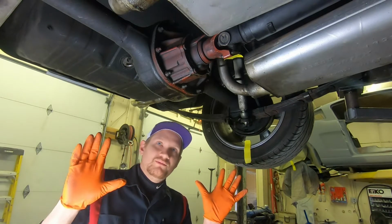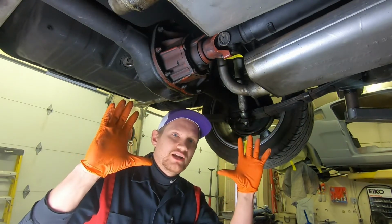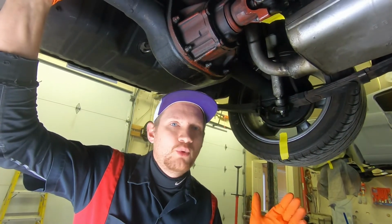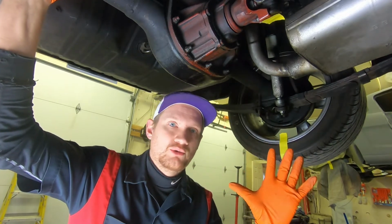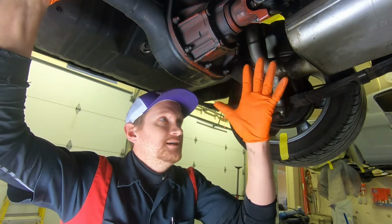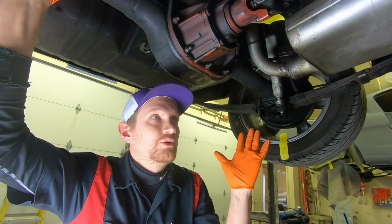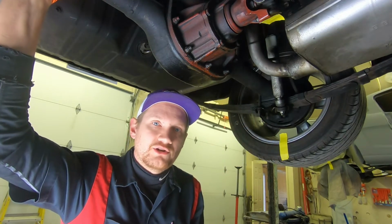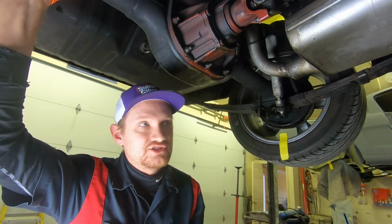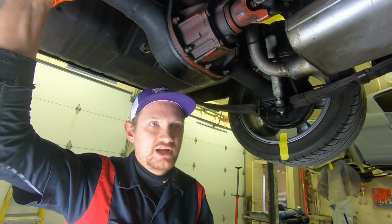But if you do a quick Google search, you'll find that Ford had certain gear ratios on their differentials. One of the Ford gear ratios is 2.79, which is really close to what our calculation is, and seems more realistic with what we were able to roughly calculate from the driveline turns, the 13 and 3/4 turns. 2.79 is our gear ratio, which happens to correspond with the ID tag on the differential. So we now know that ID tag is accurate. 2.79 is our gear ratio.